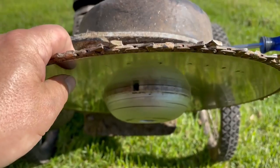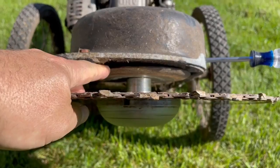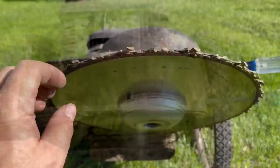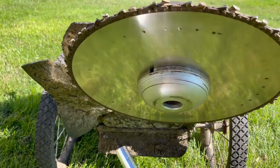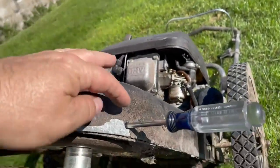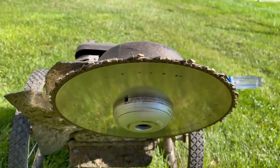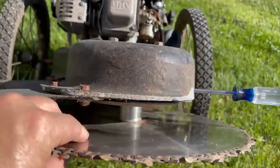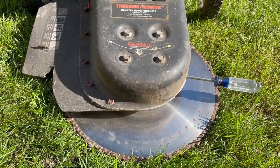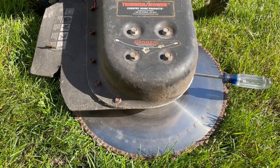You can see you've got your ball, your spacer, your protective shield — the beaver blade is installed. Easy as that. Half-inch wrench, make sure your debris is cleared, stop your rotation by putting a rod or screwdriver in the hole, and installation is pretty straightforward. Any questions or comments, please let me know. Please subscribe and hit that like — thanks for watching!